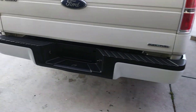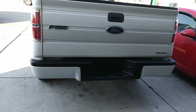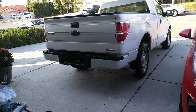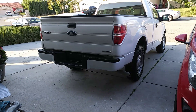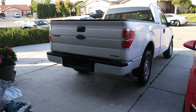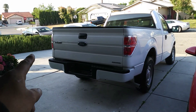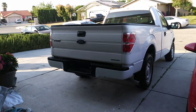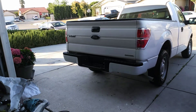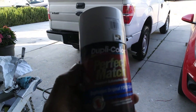Okay guys, check it out. I honestly like the way it looks, man. I definitely like the way it looks — it looks way better than that black bumper. The paint match is pretty good. I spray painted it like I did the VW Passat, using spray cans. If you don't know what I'm talking about, I'll leave a link in the description of how I painted the fender on the Passat and how you can get the paint code from your car and look for it at your local auto parts store. Get the spray cans that actually match the rest of your car.